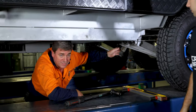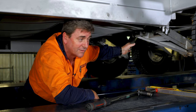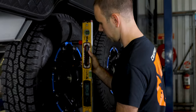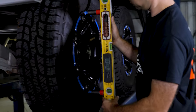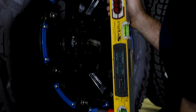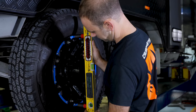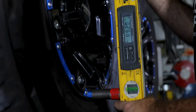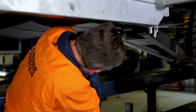The first thing we're going to do is adjust the camber and get it correct. We'll take a measurement and then make any adjustments if necessary. When placing the level, you want two flats on the rim and make sure they're even, so we're not picking up on a high spot at one end and a low spot at the other. The ideal measurement we want is 90 degrees. We're reading 89.2, so we require some positive camber. I'll just undo the nut and make any adjustments as required.